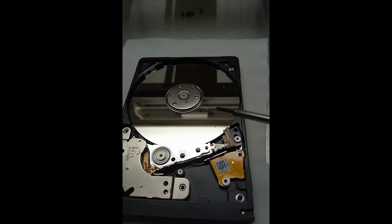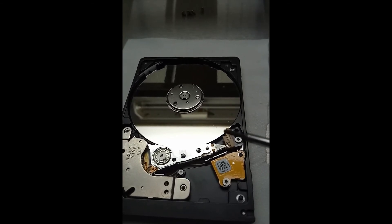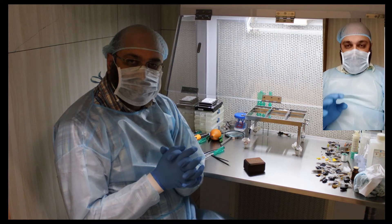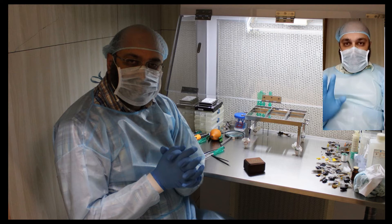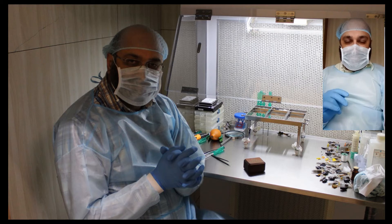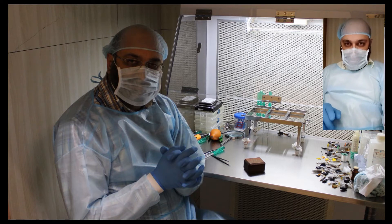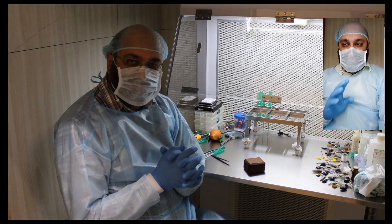Other than this area where we have contamination, I don't see much contamination on the platter. This is because when we put the old sticker back it never goes on properly, which is one big problem in these drives. This case is a little different — the platter does have contamination but I am able to work on it. Let's see if the customer is interested in getting this case done.